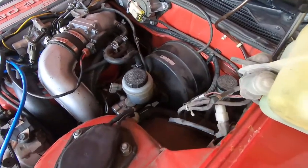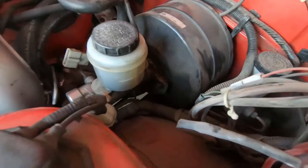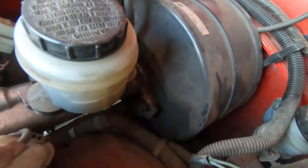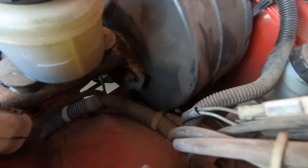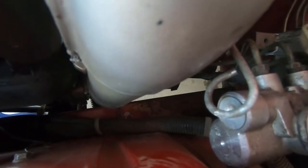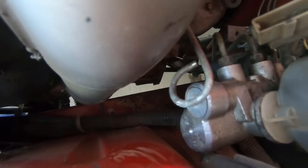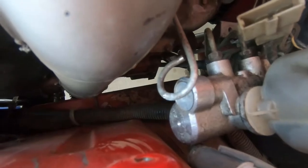What's up guys, back for another video. Today we are going to replace the 300ZX brake master cylinder. I'm guessing this is what the problem is — why my brakes aren't working. You can see down there it's probably been leaking for quite a while, and all the paint has been coming off, which tells me it's been leaking because brake fluid, especially DOT3, eats away at your paint.